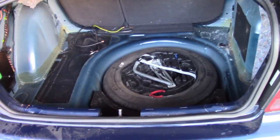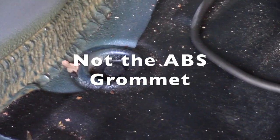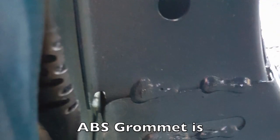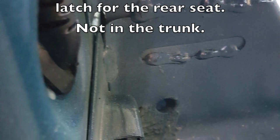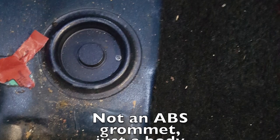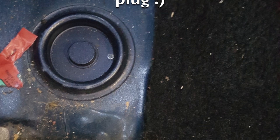That's basically it for pulling out your trunk liner. If you want to do an air ride setup, this really gives you the freedom. I'm going to run my rear air lines through the ABS grommets — there's one on each side. I may even drill through the wheel well and do it directly through there, but probably just through those ABS grommets, which go directly to where the spring sits. For the front lines, there's another ABS grommet under the seat — underneath the carpet — and I'm going to run them through there, out underneath the car, and alongside the brake lines and fuel lines.